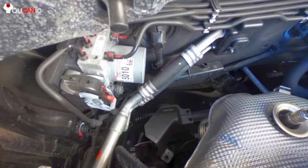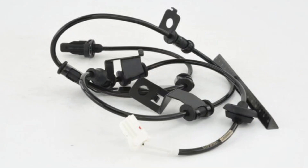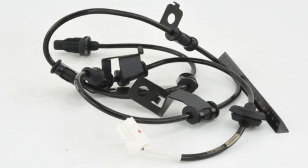The second group of problems comes from ABS wiring. A failing ABS sensor may also be a culprit, but as of now wiring problems are the most commonly reported cause of this message appearing on the dash. You should check ABS wiring, but you will most likely need to have a professional look at your car if you suspect wiring issues.